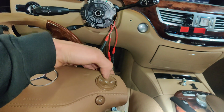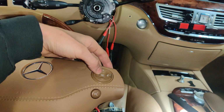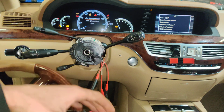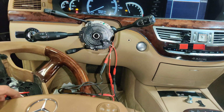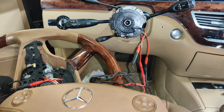Our radio works. Let's turn that off so I don't get demonetized. So look at that. That all works. That is awesome. Got all kinds of stuff coming up. So there we go. We proved it. Proved what it is: the clock spring. We saw it was broke, but now we just proved it by bypassing it.